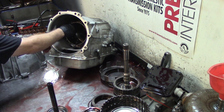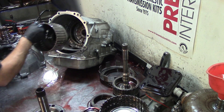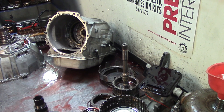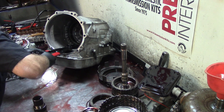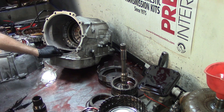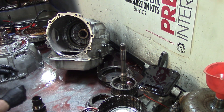Removing the 1-through-4 clutch hub and the 3.5 reverse clutch hub. Let's get the big pliers — and there goes the camera. Let's get this big snap ring out of the way. Looks like somebody was having trouble with this snap ring getting it in and out — it's all beat up, looks like it was being hammered.